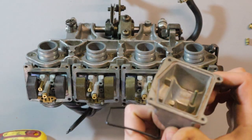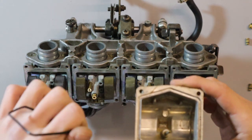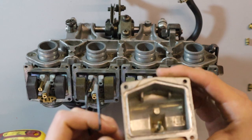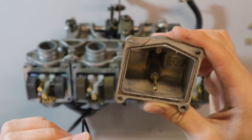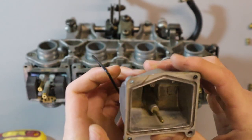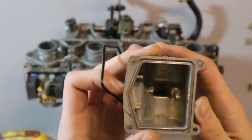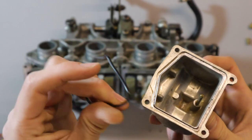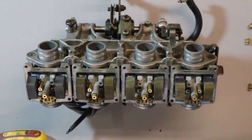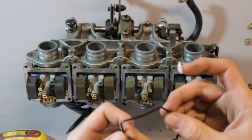Okay, so when you're putting in new seals, it can be a bit of a hard one to seat into the actual component itself. So if you have a bit of silicone grease, which is really good for sticking together, you don't want to use any other different greases that could potentially damage the seal or start corroding or affect the economy of the fuel system. So by using silicone grease, it's like a natural grease that's non-corrosive and it won't damage any of our parts. Petroleum jelly is a really good one.